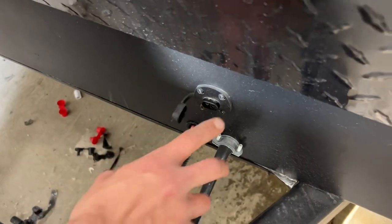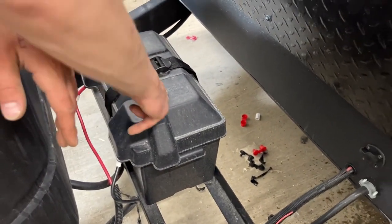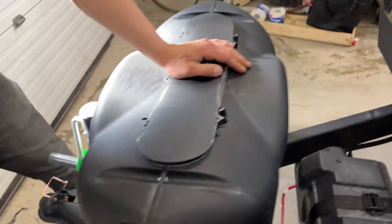At the front of the unit, you've got a little two-prong plug inlet right there — that'll be for a solar panel. You just plug it in and it charges the batteries. The battery itself is housed inside this box right here. As long as you're plugged in through the shore cord in the back, or your seven-pin to your tow vehicle, the battery's charging for you.